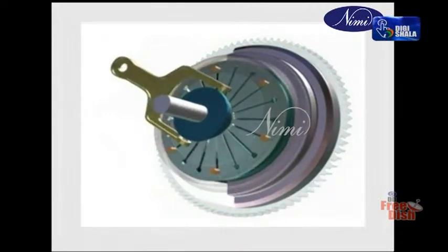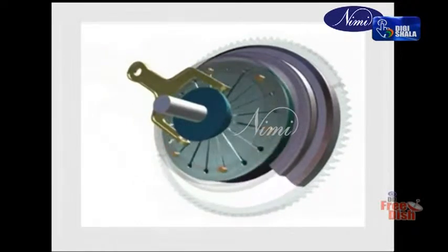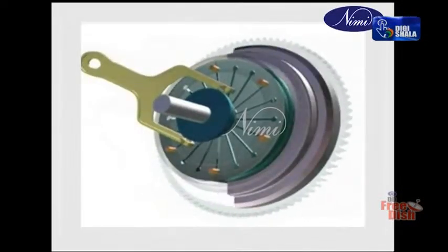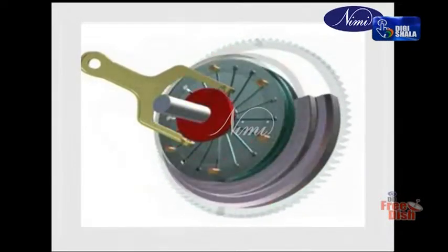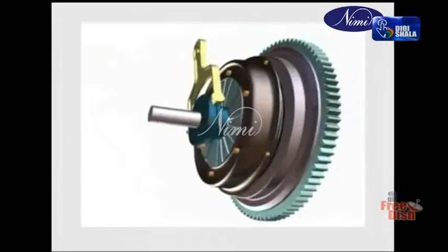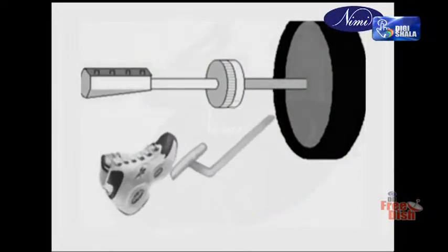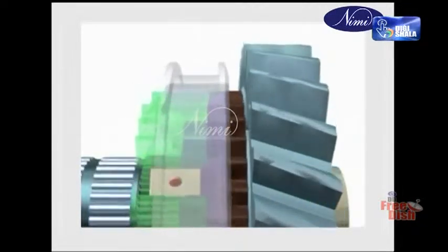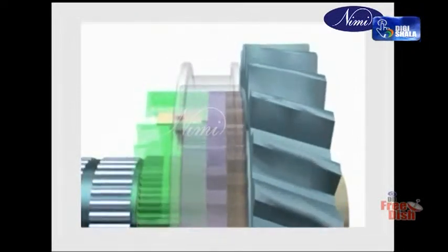Friction clutches: a friction plate sandwiched between the engine flywheel and a spring-loaded pressure plate transmits the drive to the gearbox. The extent of the drive is controlled by the force which is clamping the plate. Lowering the clutch pedal causes disengagement by separating the friction surfaces. During this operation, the force of the spring is taken by the driver. Initial upward movement of the pedal causes the friction surfaces to contact. Further pedal movement allows the full spring force to act on the driven plate to ensure that all plates rotate at the same speed without any slip.